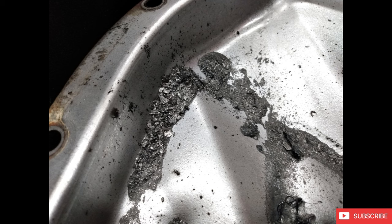I say almost because the studs were a little bit wider dimensionally than the holes in the crossmember. So I did have to go in with a die grinder and elongate the holes in the crossmember where the engine mount studs sat. But again, nothing that couldn't be taken care of in about 10 minutes with a die grinder. No real fabrication, cutting, welding, nothing like that. It was pretty nice to be able to just drop it right in.